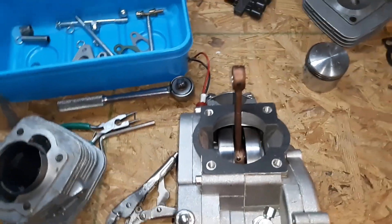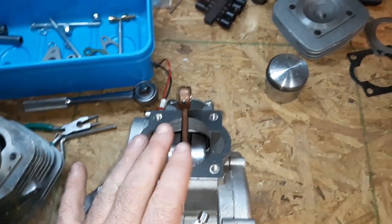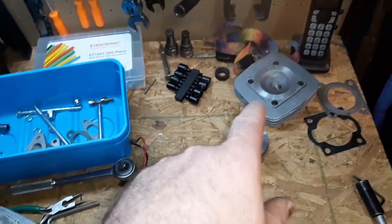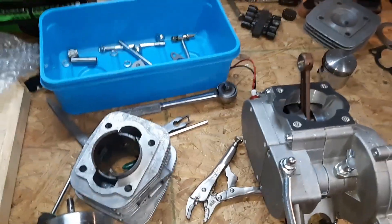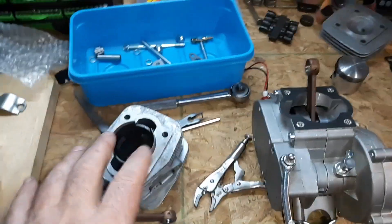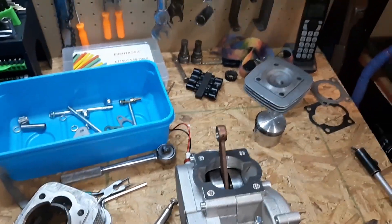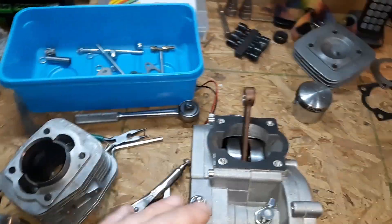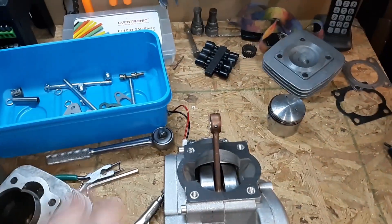Getting the right stroke length — anyway, that is the problem. We have too short a rod. They did it on purpose, because even with the material gone it was still hitting the top, so they had to put a second gasket on. But if this was the right height and we had the right stroke length, this would be gangbusters. In the next video, I'm going to throw this on as-is, time it all out, and see how bad it really is. I'm not even going to try and cut the ports to match, because there's too much off with the transfers — it's not going to fully open.